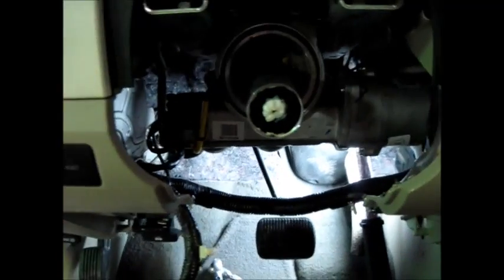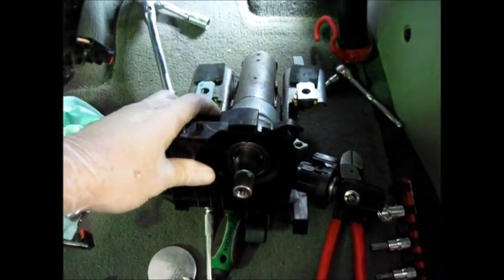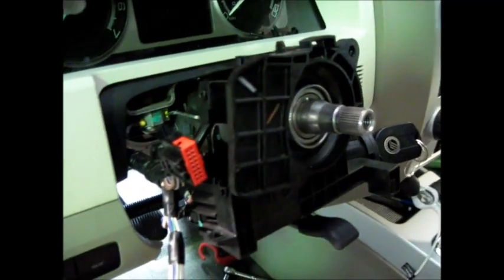With this piece in place, it moves up and down because that's part of the tilt column setup. Now we can take the top half of the column and slide it in over this — it's going to bolt on here and here. Now we have the top half of the column installed. You can see everything down underneath there. That silver bolt right there is one of the bolts that holds it in, and that's another one just like it on the other side. You can see the column tilts like it's supposed to.